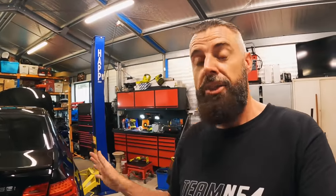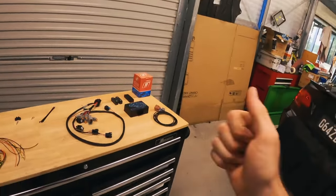I was thinking about going to a return fuel system like what we did in the Flowmax — that thing is just so much more fuel than the Flowmax turbos are ever going to need. It is a 1,000-plus horsepower fuel system. However, Ken said that with the PWM control we're probably not going to need it on this car, so we won't need to do a return fuel system. When you have accurate PWM control of your fuel pump, you can basically change the duty cycle to ensure that fuel pressure at the front is correct regardless of boost. So you can use electronics to compensate for the boost pressure in the manifold.